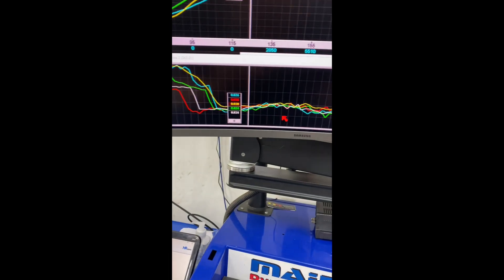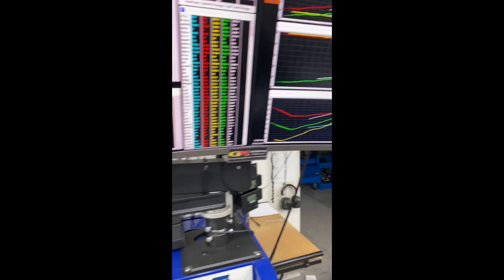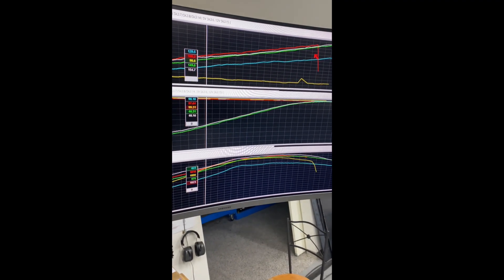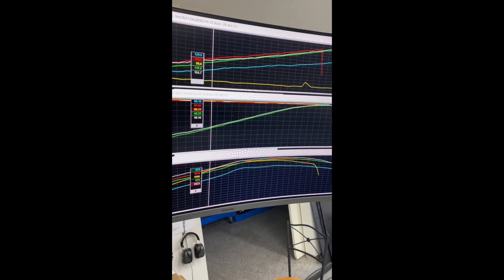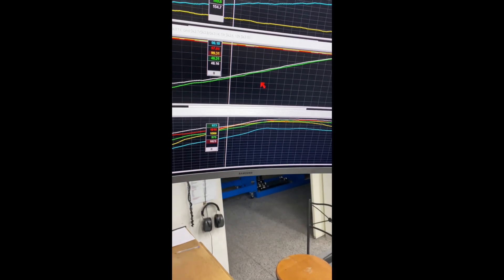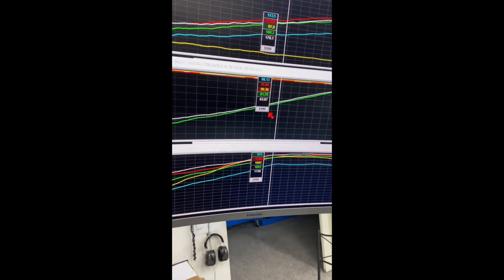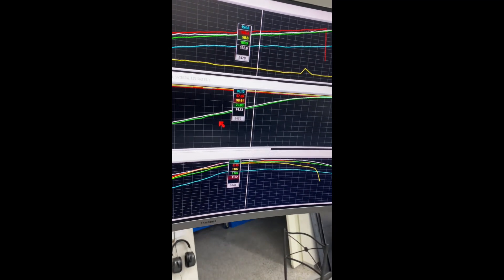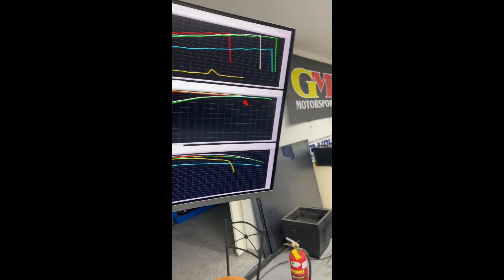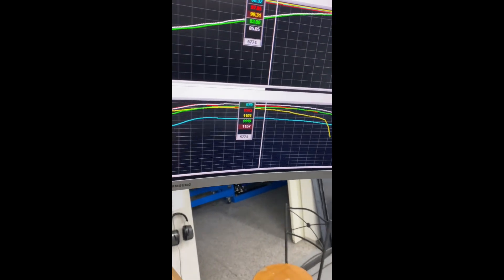Here's our lambda — you can see the red dot and cursor — and over here is our boost relation, so you can see where we were and where we ended up, about 18 to 19 pounds of boost. The red cursor here is our injector duty cycle — you can see it going across up there. Mid-range, even at peak torque, we've got enough injector in the 70s right up to 6,900 RPM, then we max the injector out — so no more power for this car.